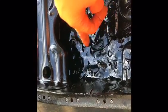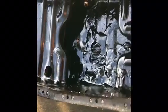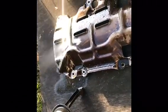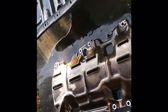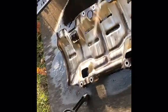Just from visual inspection, you can see the gunk that was in this engine. I could have not opened the engine and just tried to run it — and this stuff still would have been in there. So I'm glad I'm taking it apart. Can't beat clean. Go to town. I set them all up on this piece of wood to try and get them off the grass and keep dirt from getting to them. I still may get these parts hot tanked at the machine shop — see what it'll cost. I want to keep the cost relatively cheap, but I also want to do it the right way. If I can get these clean enough with just a little brake clean and maybe a scrub brush, I'll be happy.